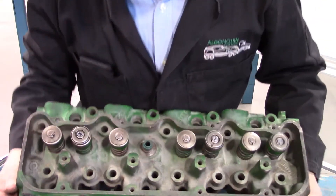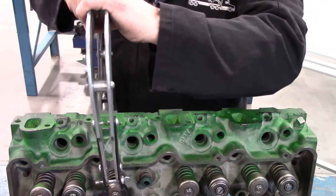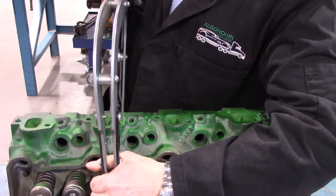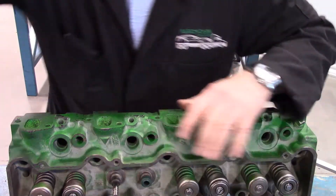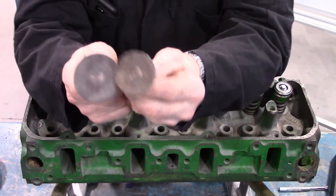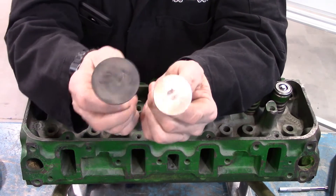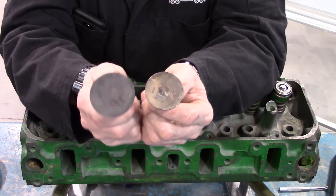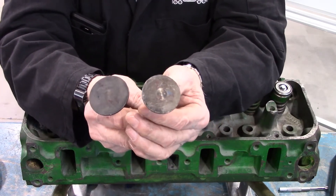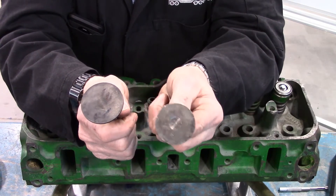I'm going to go ahead and take another valve out — that was an exhaust valve, so we'll take out the intake valve as well. So now I have two valves removed. Just to compare them, you'll see that there is a noticeable size difference. The exhaust valve is always the smaller valve; the intake valve is a little bigger. That is to make it easier for air to be pushed in if it's turbocharged, or drawn in if it's naturally aspirated. When the exhaust valve opens we have exhaust blow-down, and then the piston acts as a pump to push the exhaust out — so not as much trouble getting the exhaust out through the smaller valve.